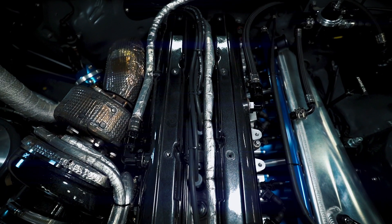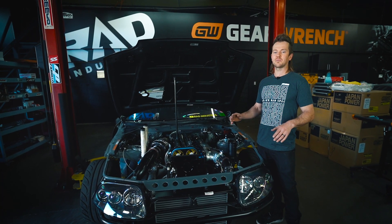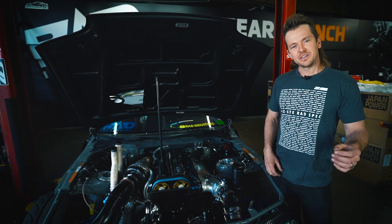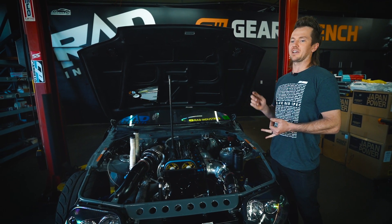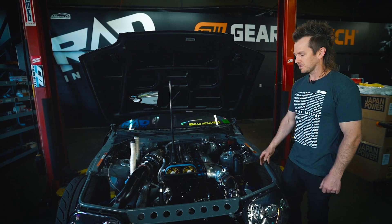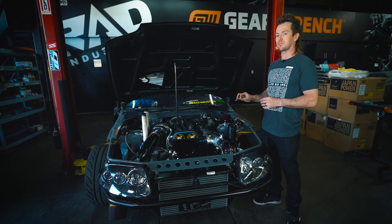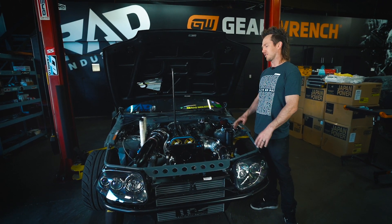Going into the head, we use all GSC valve trains — springs, valves, everything — and GSC S1 cams, 268 cams. Not the highest lift at all, but I'm just trying to do good power for drifting, so it's super functional. Over the years I've kind of dialed in the pieces in the motor to work exactly how I like and it's very reliable. We still run a stock GTE motor with oil squirters and run ACL race bearings. I always run Torco SR5R 20-50 motor oil and I've never once had an issue with a single 2JZ motor I've built and been running myself — never blew up a motor. Good success with the stock oil system. I modify the pump routing sometimes a little bit, but I run a stock wet sump, no dry sump.